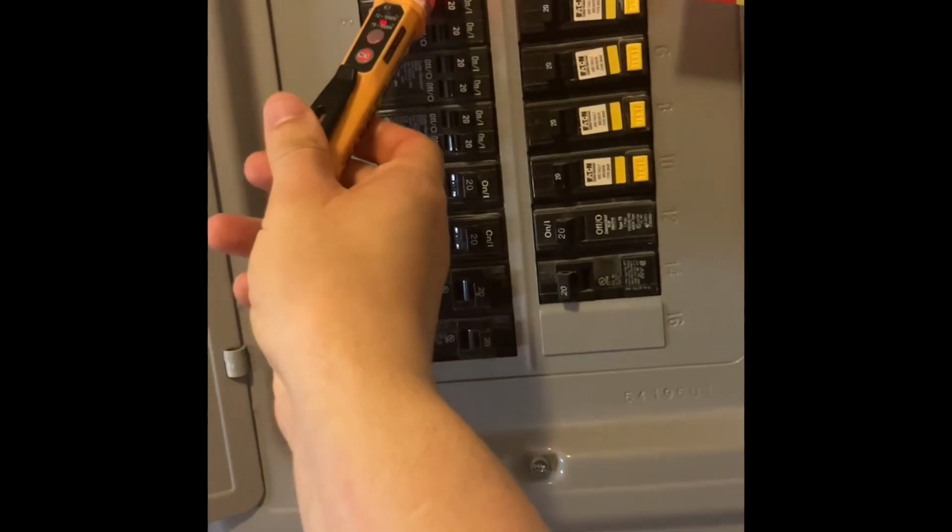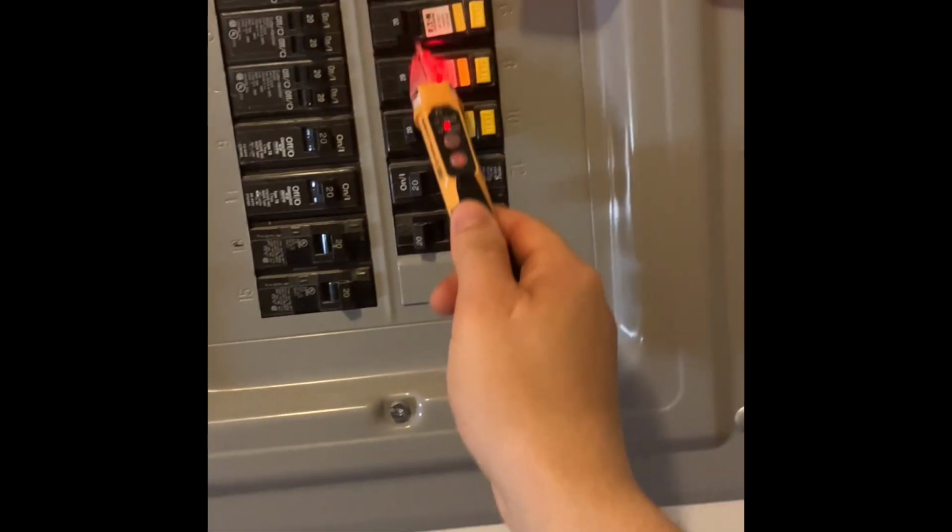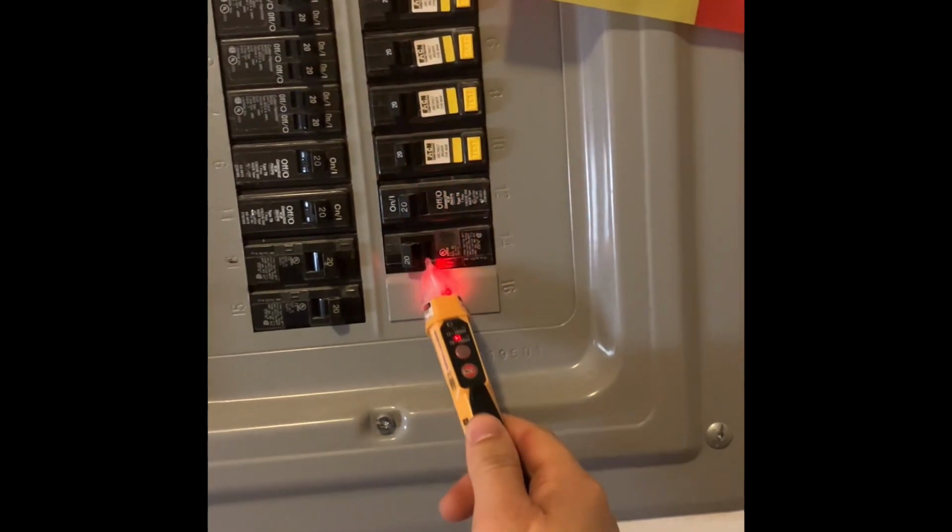First, let's confirm that the breaker is fine, there's nothing tripped, and there is actual power going through all of the breakers. Remove the front door boot seal by popping off the ring and then sliding off or peeling off the door boot seal. Take your non-contact voltage meter, if you have one. Hopefully you have one. This is a mandatory tool for all technicians. It saves you a lot of time. So you're gonna put that non-contact voltage meter on the door lock harness, see if there's any power coming in, period. On this one, we happen to have power coming in intermittently.